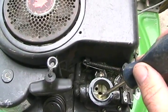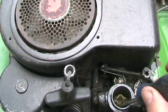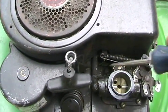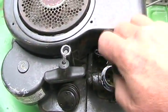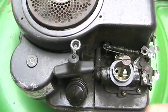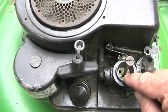Next step on your Choke-O-Matic carb: always check that the choke is working. Push it all the way to open and see if it closes all the way. If it stops halfway or stays open, it's not likely going to start unless you prime it with a bit of gas — you'll likely have to change the diaphragm and clean in there. Never attempt to start a Choke-O-Matic without the screw in part way. The screw goes right into the gas chamber of the tank, and if you try to start it without it, too much gas comes out that screw hole, flooding your motor, and it can't get the right amount of choking.